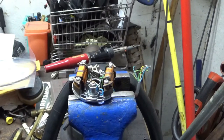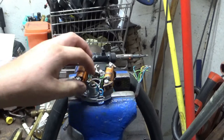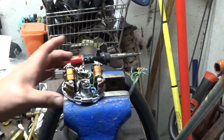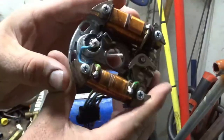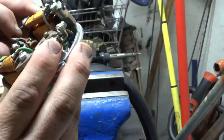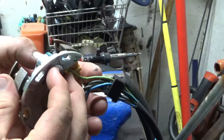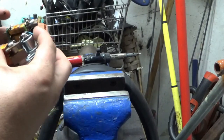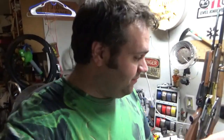I need to find some loop connectors. I changed my mind last minute — as soon as I put the fitting on there I realized that was never going to work, so I just went ahead and soldered the wires on there. Not the prettiest blob of solder on earth, but it's not falling off. Honestly I may be stuck trying to find a stock condenser, which is not easy to find, but hopefully that will work. Guys, I suppose that's it for now. I have to wait for the clutch puller to come in before I can transfer the clutch over to the new crankshaft, and then we can put the engine back together. Hopefully it will fire, hopefully it will have spark — if not, I have some more work to do. Keep your fingers crossed that this will work. I will see you guys next time, thank you for watching.